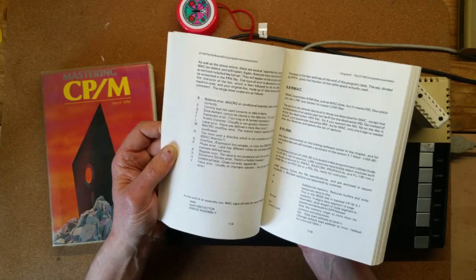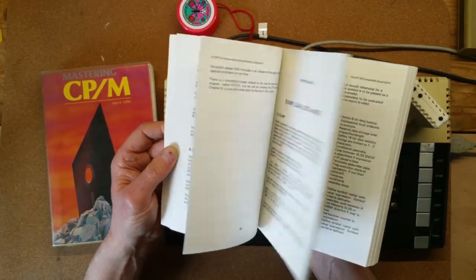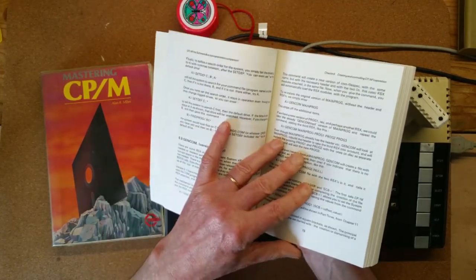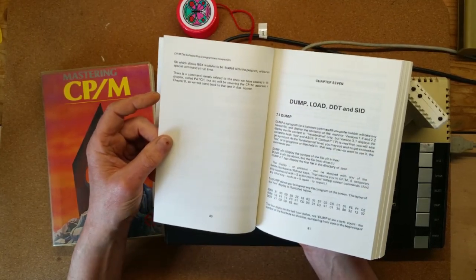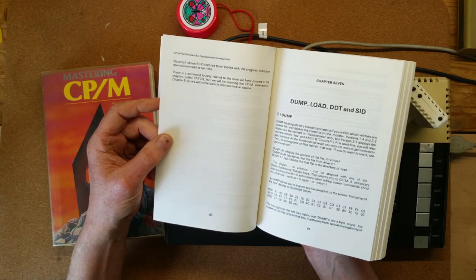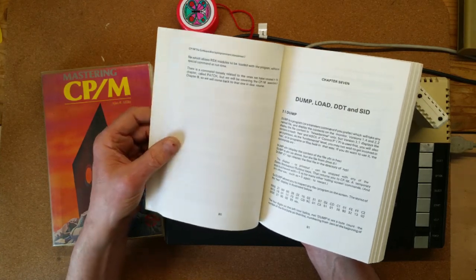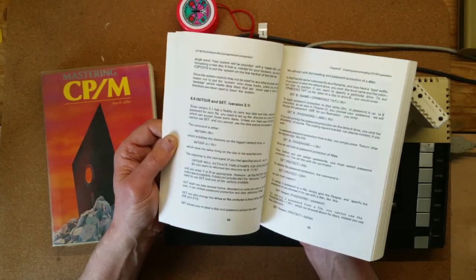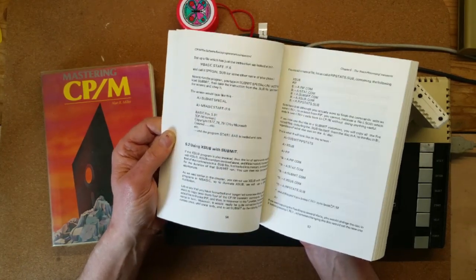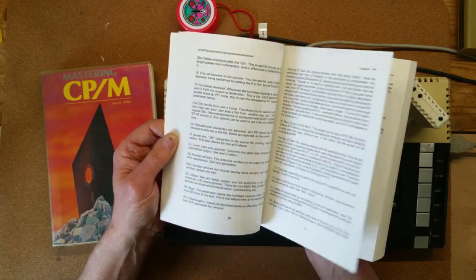Of course, truth be told, CPM isn't actually running on the Atari, but rather it's running on a real or emulated Z80 attached to the Atari and accessed via a terminal emulator such as Ice-T, BobTerm or VT850. Ideally, output will be 80 columns, either hard or software generated, and I'll look at several of these options.